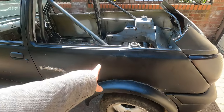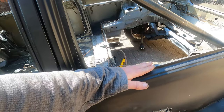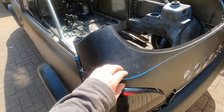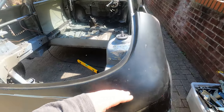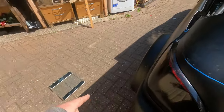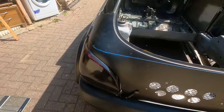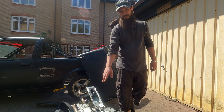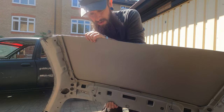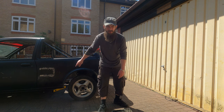Chopped a bit more here - I think really it's maybe a question of not cutting too much and when you do the bed have an edge that comes back and then make it smooth around. Chopped the bumper a bit quickly as well. The trick is going to be making it nice and straight at the back. From the chopping point of view it's pretty much there. I'm really curious about how much weight we've removed so far - roughly 15 kilograms there, about five kilograms there. So far we've roughly chopped another 30 kilograms, not counting the windows.